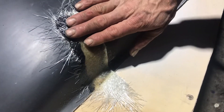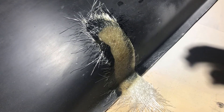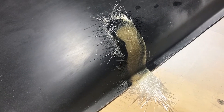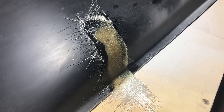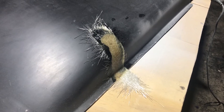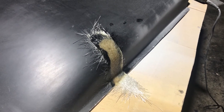Folks, we've got this pretty much finished. I'm just going to grind over the top of it to prepare it for body fill, and that's as far as we're going to go in this video. One thing I want to say is that it's not that difficult, but you do have to have all the chemicals right — otherwise you can end up with disastrous results. A good tradesman will make things look easy, but there are lots of things you have to be very careful with, particularly when mixing the chemicals and making sure you get all the air out. You can't have air in there. If you're not proficient with the grinder, maybe use a sander instead, because you can end up doing more damage than good.